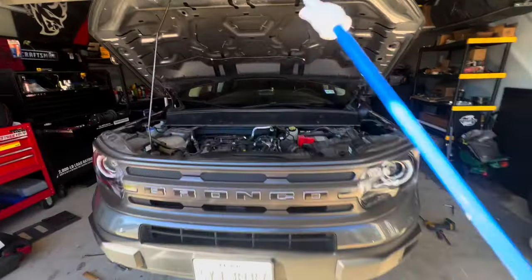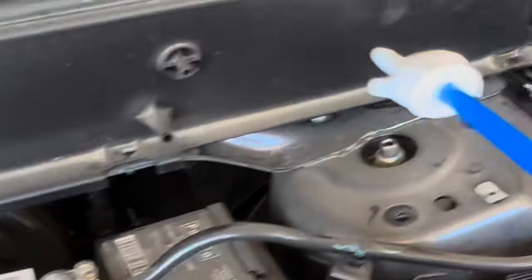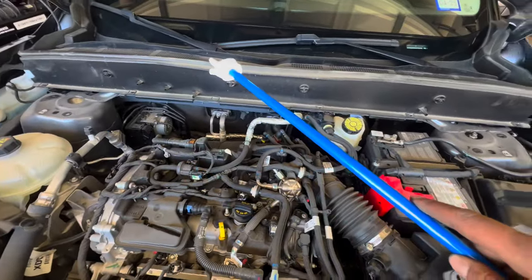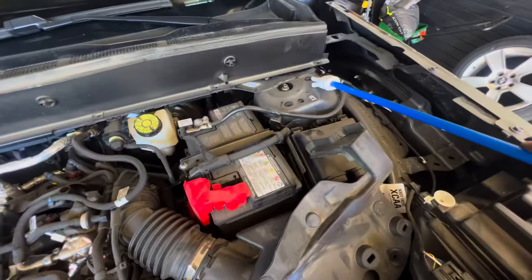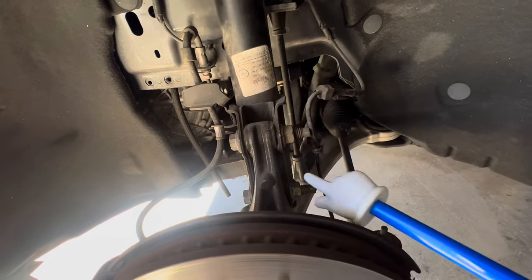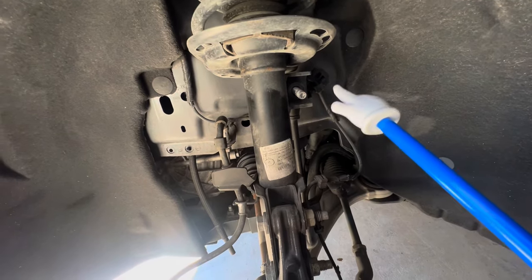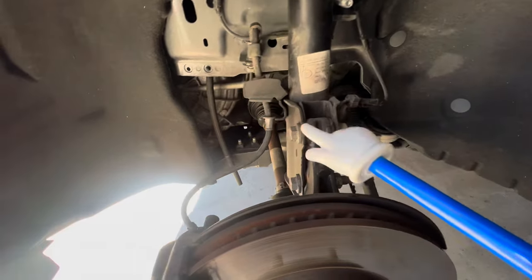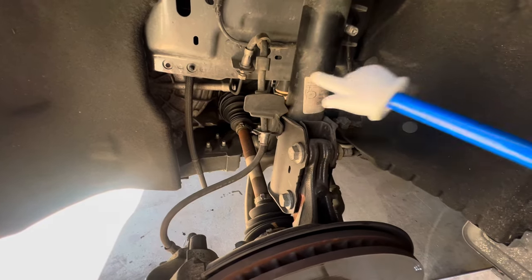Open the hood on your Bronco so you can access the cowl. Remove the plastic clips holding the cowl in place — they're right here, all the way down. Lift up the cowl and remove a 10mm bolt that goes here and one underneath in the back, which removes a cover that exposes the top hat so you can remove those three bolts. You've got some sensors to remove, one tree that clips into the side. Remove your sway bar end link on both sides at the same time so there's no binding issues. There's bolts holding this assembly and one 8mm bolt holding your brake line in place — that's really important because you don't want to take that with you.